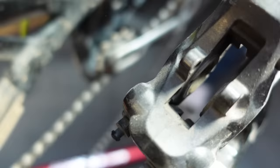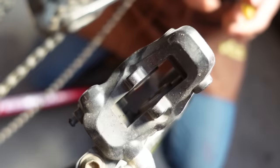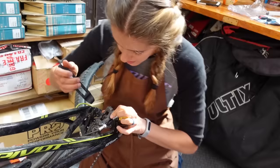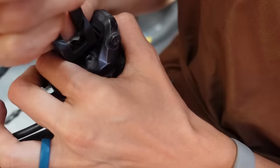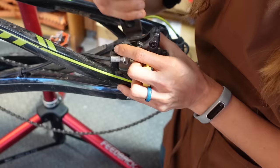We're going to install the brake block, but you can't install it yet because the pistons are pushed out and there's not enough space. So Syd is going to use a plastic tire lever — you can use a metal one but be careful, because if you're not careful pushing the pistons in you can crack them slightly. You want to push in the center of the piston, levering it against the caliper. It will never be totally flush. If you have four-piston brakes, the process is exactly the same except you have to push all four pistons in, not just two.